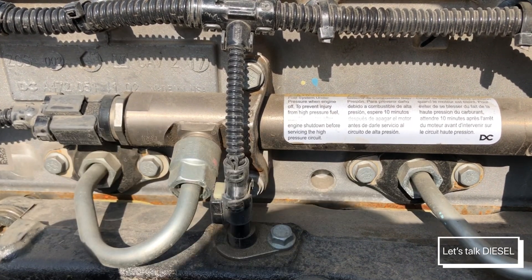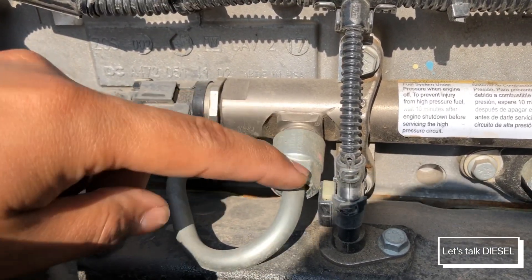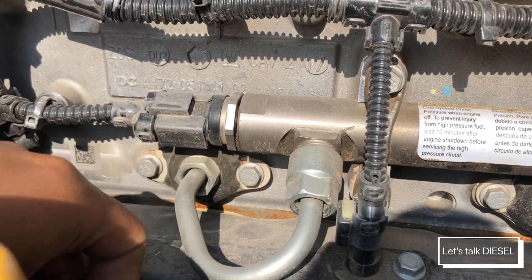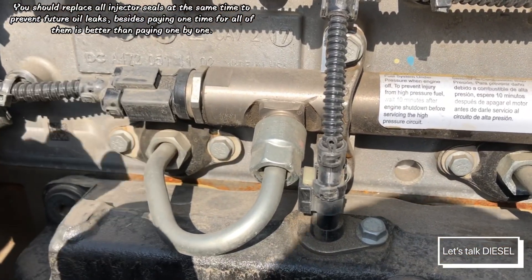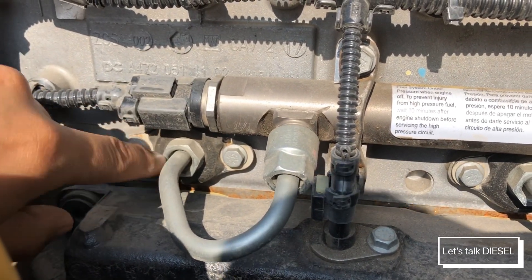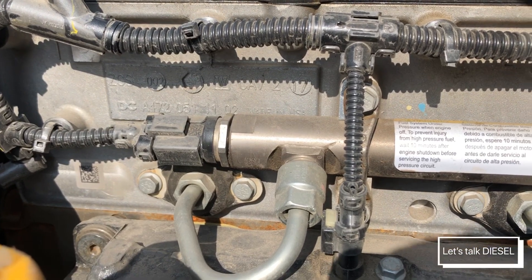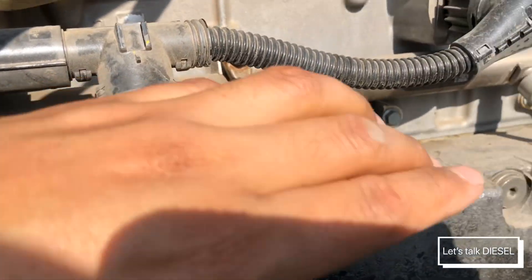This is the first outlet port that goes directly to the first injector. And this is the injector seal — this one usually leaks oil and can make a big mess on top. If your truck has that kind of mess around it, you should replace those seals. You can spot the oil around here, and if you see any leaking, replace all of them at the same time — don't just replace one.